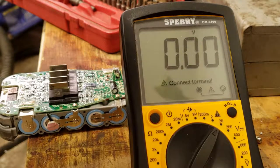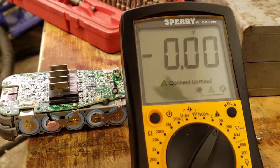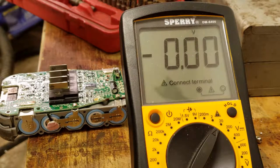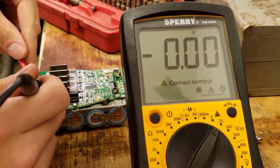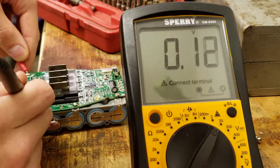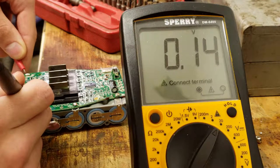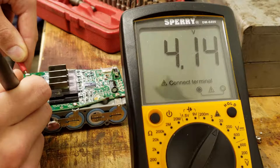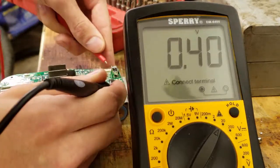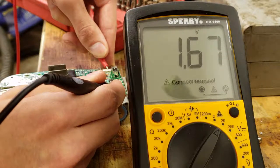So there is something else wrong with the wiring as to why it's detecting a fault or a faulty battery. Let's check this voltage here — what is this voltage? Reading 14.4 volts across the pack.